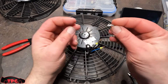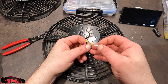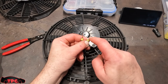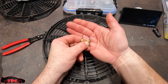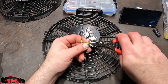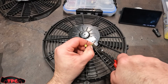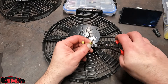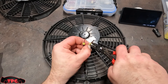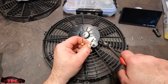Take the little connector and fold these little wings so they grab onto the yellow part of the insulator. Cut the wire so it fits underneath that rectangular opening — the wire shouldn't be too long. Take your crimp tool and fold the little wings over onto the yellow insulator so it's all held together. Just grab it and roll one end under, get it nice and flat, and roll the other one over top of it. Once it's onto the yellow part, crimp it back and forth until the wings overlap a little bit.